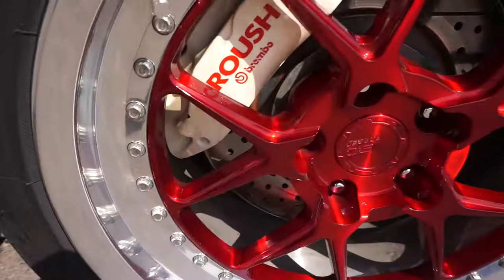The specs on these - they're custom-made wheels. The fronts are 18x9s with 5mm backspacing. I did spec them to fit the Brembos, as we do have the ATS Brembo swap on there. We do have a video on the channel on the whole install - I think we ended up spending like $350 for everything on that. They look sick behind those BC Forgeds and they work great.